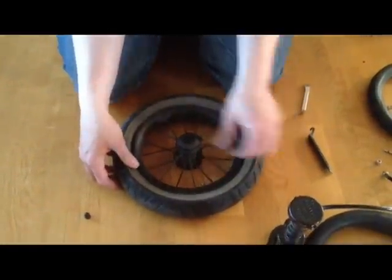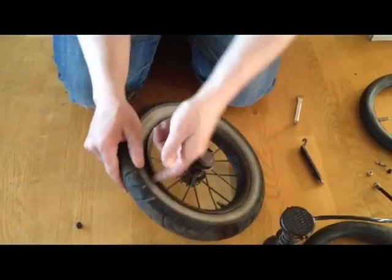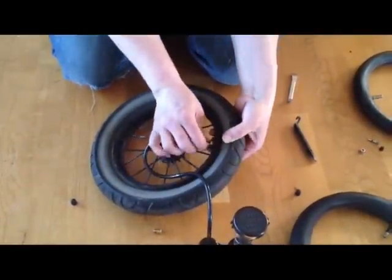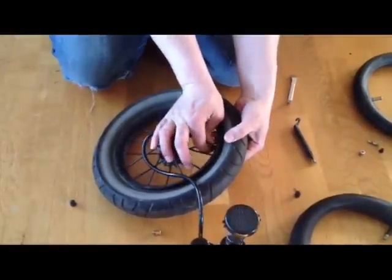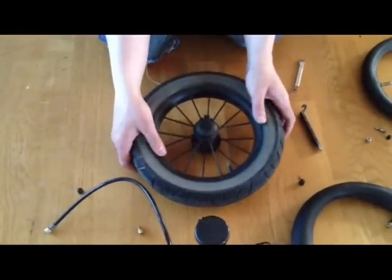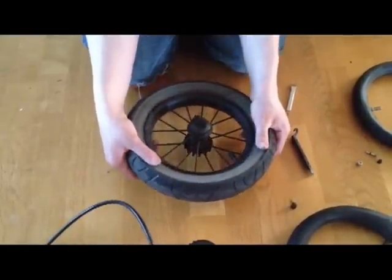Make sure that the tire is positioned as equidistantly as possible from the rim on all sides. The tire always has a slightly different pattern close to the inside, so you can use that to eyeball where it would be centered. Check this as you pump, because if it is positioned more to one side it will look lopsided as the wheel turns and can eventually cause the inner tube to pop out. Hold it as equidistantly as possible and begin pumping. We have now finished replacing the inner tube. Put the cap on when you've pumped it as much as you'd like — it is not always necessary to pump wheels until they are rock hard.